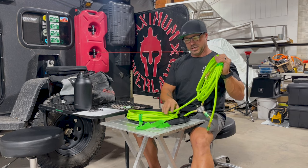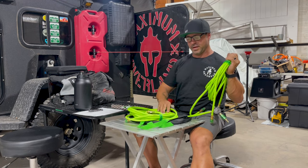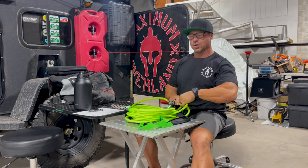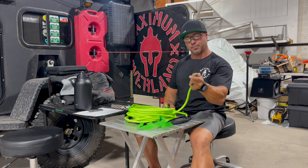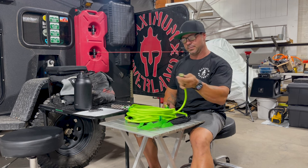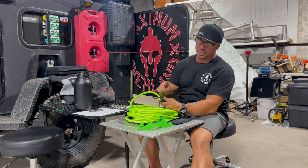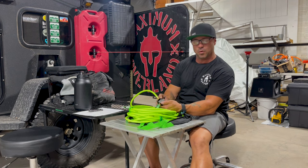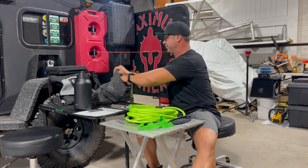You'll see that you'll have two different legs. One goes down one side of the vehicle, and the other one goes on the other side of the vehicle. Super simple, quick connects, quick on, quick off. You push it onto the valve stem, press this down, and it holds it on, okay? It's really simple to operate. You plug this in, and from here, you can remove this and put a digital gauge or a mechanical gauge, just like this one's done here.